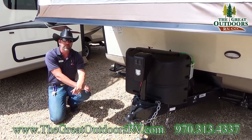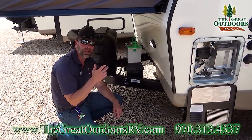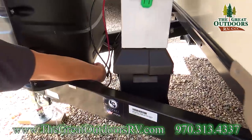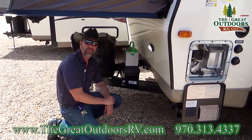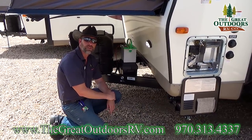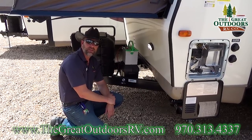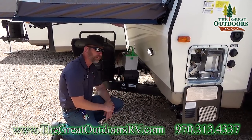You're also going to have a security light up front and two 20-pound LP bottles with an easy one-for-one exchange rate. The 24WS also has a quick-disconnect battery disconnect right up underneath here. To turn off the power, you just crank it to the opposite position and it totally kills the power to the coach. This is important because your LP detector is going to draw power 24/7 even when you think everything is off.